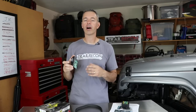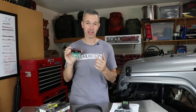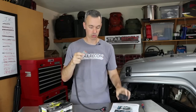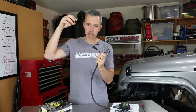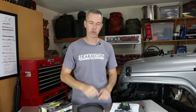You can have it off, at 50% responsiveness, or 100%. They do offer an external switch which allows you to adjust this outside of the vehicle, because once we close this up you'd have to pull it all apart to reach it. I think I'm just going to set this at 100 and leave it. We've also got the wire loom — the gray part attaches directly to the throttle sensitivity module, and the Y side is where the current cable going to the gas pedal plugs in, and then this plugs into the gas pedal. That's how the connection is made.